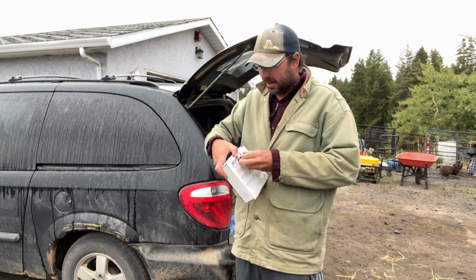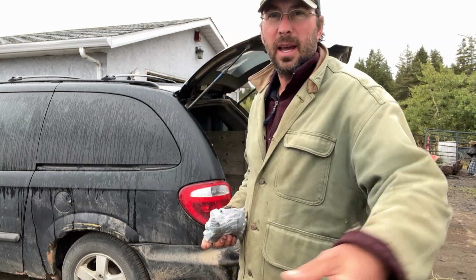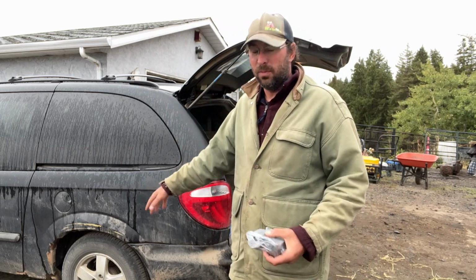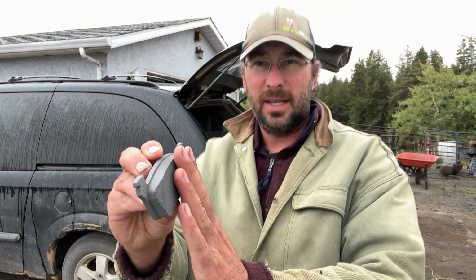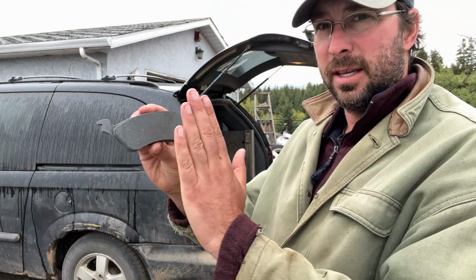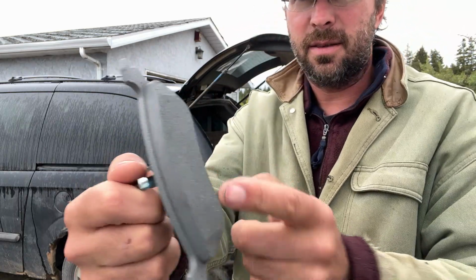I have new pads and rotors. For those that don't know, what I might do is flap my gums here about what I'm doing, and then just do a quick zoom through on one side, and then we will do a separate video. These brake pads here, this is a new one. So they squeeze down as the rotor's spinning, so your wheel's spinning, and there's a part attached to the wheel, and then these squeeze and put pressure on, and that squeezing action, and this material right here is a consumable, so this gets used up every time you brake.